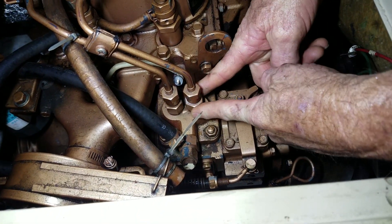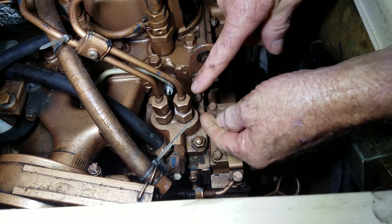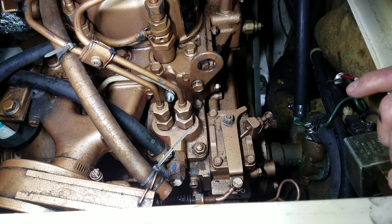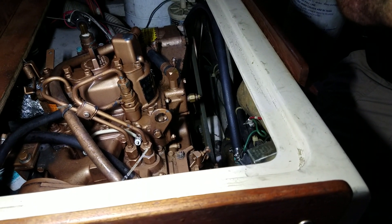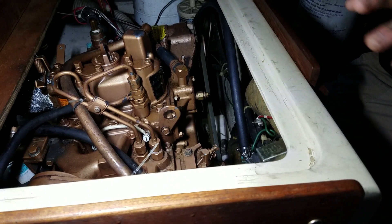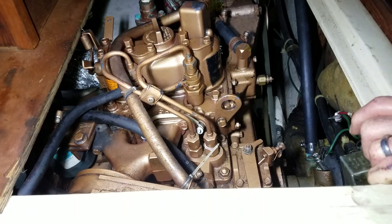There's a little piston right down inside here. This is a delivery valve — a check valve — so it doesn't let fuel go back. The piston in each one of these is not really a piston like in an engine, it's just a rod. But it's extremely tight tolerances to its barrel. When the cam hits it, it's like a piston in an engine — it just pulses. It's not a big long process because the volume is nil and the pressure is extreme.